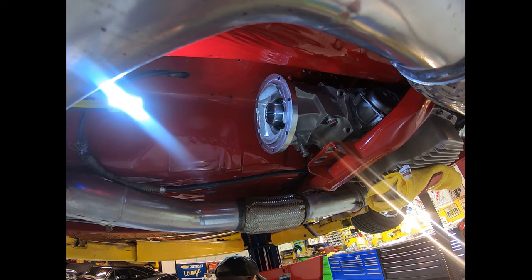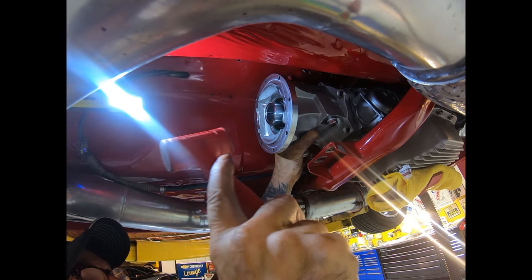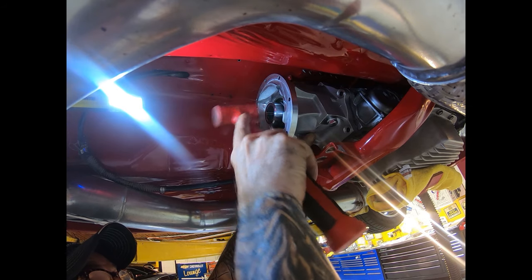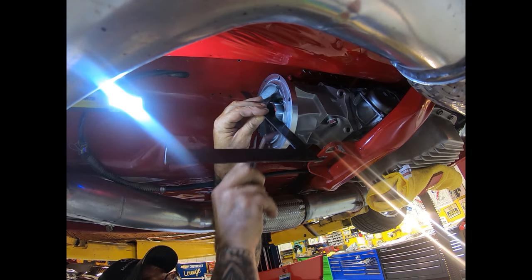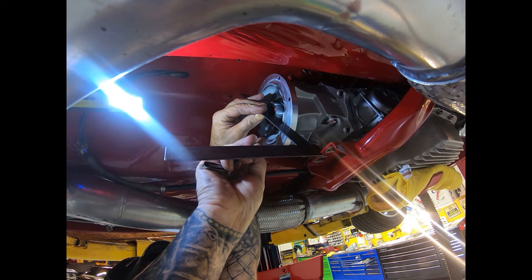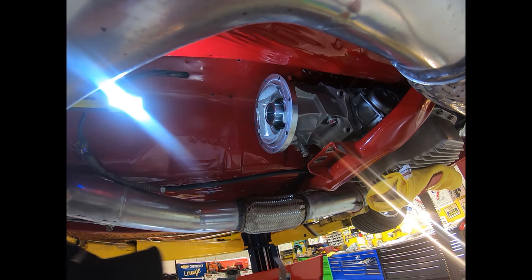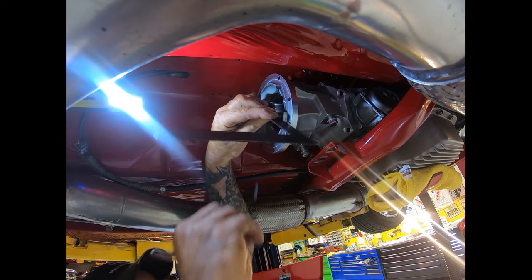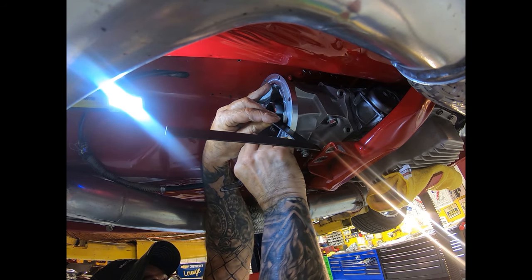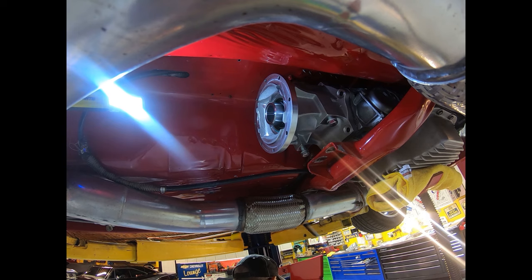Okay. So, I just put the tail shaft on and tapping her in, making sure. Line here. And here's what I'm checking. Check this across. What I gotta do is make sure I have less than 20 thousandths. And we have 14 and she's rubbing, so feeling pretty good. Just to double check, I'm gonna double it up, go to 30. And I can't get it in. There you go. Perfect. Alrighty. So we now know that we're in good shape there.